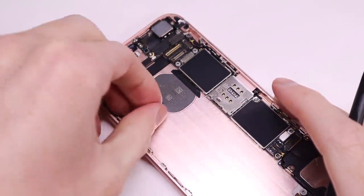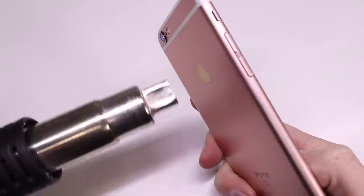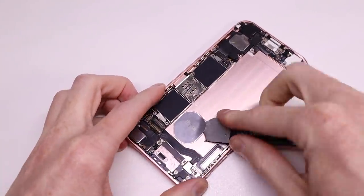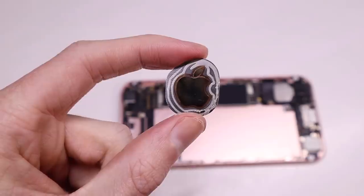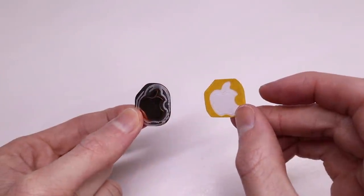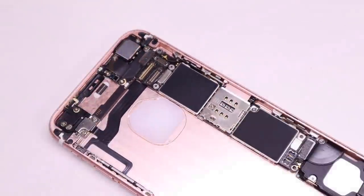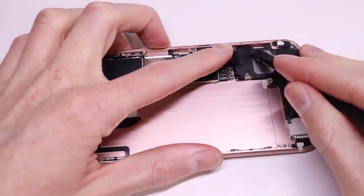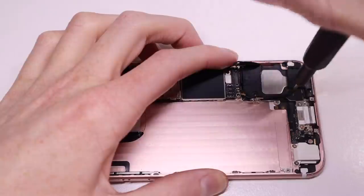The first tab I removed actually snapped but I was able to get it again as it didn't go back underneath the battery. The second one came out fine. Next I can begin work on the Apple logo itself, removing the bits of tape holding it down and heating up the Apple logo with a heat gun to soften the adhesive, which makes the logo easier to pry up. Now that I've removed the logo it is a little bit scratched, but luckily we're replacing it with a new one. Comparing the old and new logo, the new one is transparent on the front, not the same shape on the inside, and also a little bit thicker — that's so the LEDs can shine through, as the LEDs are located at the bottom of the logo.